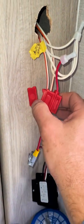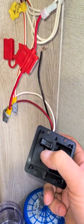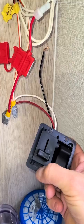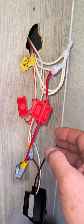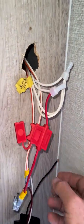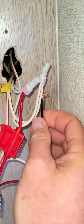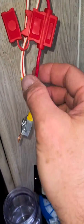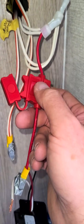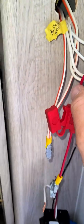When I put the fuse back in, the switch on here works great. The dimmer, however, I'm only getting a voltage drop of, I think it was 12.78 to 12.74, just hundredths of a volt, which I don't think is going to really affect much of any light control. Then I take my black ground and mate it up with that bundle of 3 grounds. So off my new dimmer, I've got my ground going to what I presume is my 3 solid whites, which I assume are grounds. My red off my dimmer connects directly onto the spade connector temporarily, which is in line with my 5 ampere fuse, and which then pigtails to the blue stripe.